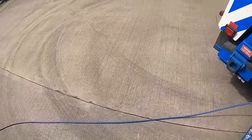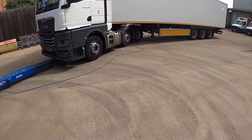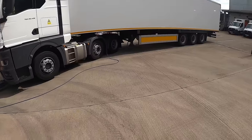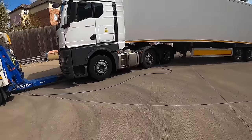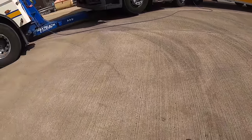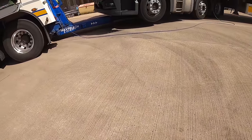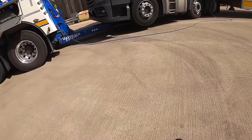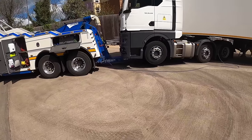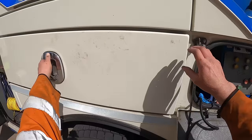It should be able to roll now. Sometimes if the air does go down it puts a park brake on the trailer, but we're rolling nicely now. I don't think it's quite fully loaded — I think he's done a drop earlier. Just going to stow this up a little bit. Doesn't seem very heavy, moved quite easy on the stow. We'll leave that airline in there and get some Susie lines out — yellow and red Susie. I'll put my cordless trailer board on the back with my number plate.